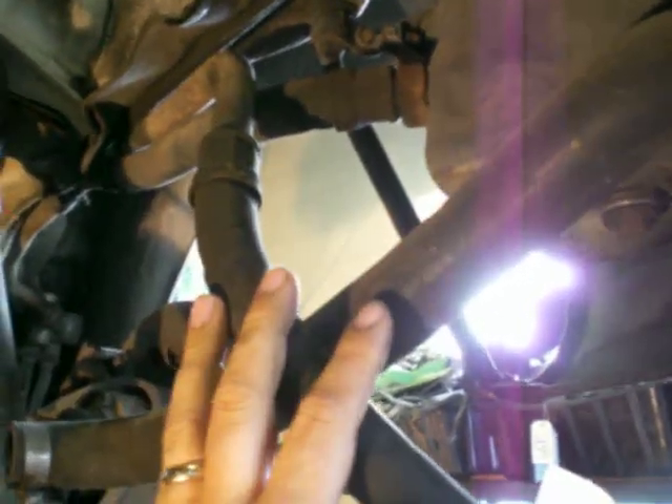Right here you have the main oil line. You can take this and twist it at this crimp right here — this crimp is loose. With the new motor, a lot of crankcase pressure will hit it, it'll start leaking. It's already been leaking, and this is going to leak worse. Right here, same thing. These two lines are bad.